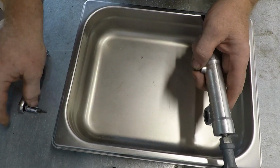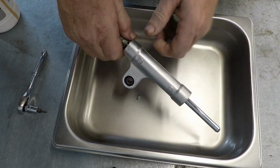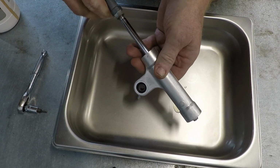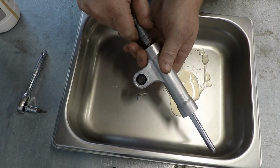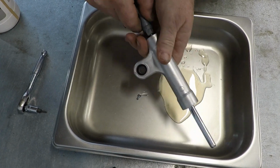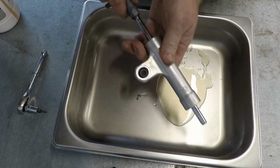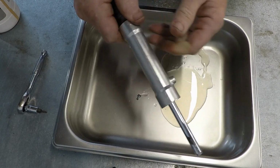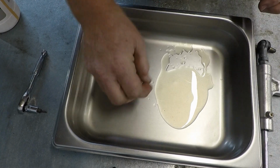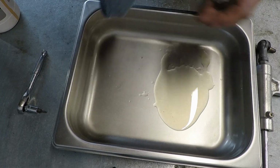According to the manual, these are non-serviceable, and they are a pain in the backside to service, but you can replace the oil quite easily. The oil that's coming out, as you can see, doesn't look particularly bad. It's not foamed up, it's not all black and horrible like you get out of a pair of forks, because it doesn't do as much work as a pair of forks. The big problem here is that there just wasn't enough of it in there. Tiny amounts will leak out over time, and this probably hasn't been opened up since the bike was new.